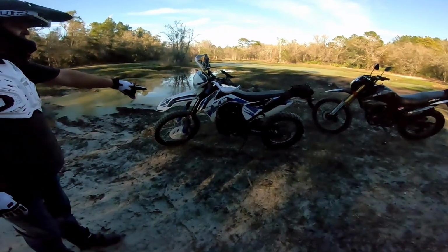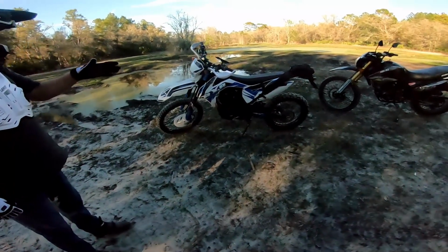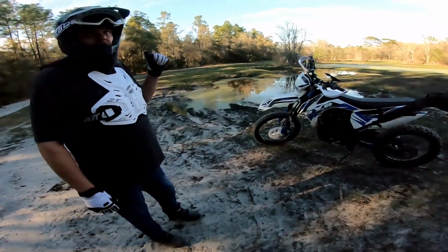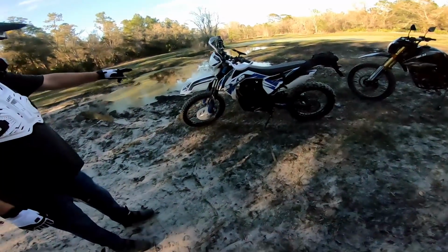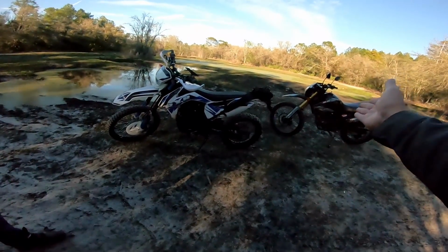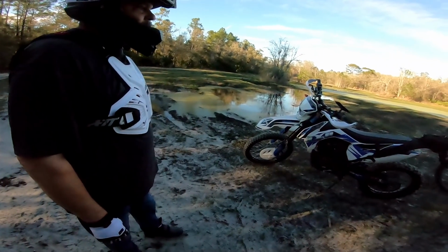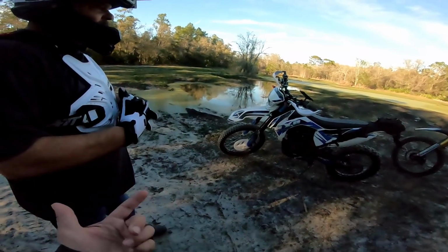Now, the next version of this will be a little more. That sixth gear will be kind of a hybrid where I can still have my low-end grunty off-road gear. Something for the highway, yeah. Because this thing redlines at 10.5 now with that rev box. And if they go to that pushrod engine, you're not going to be able to go 10.5. It's going to be a torquey motor. I don't know how they're going to cam it. There's only one lobe cam in there.